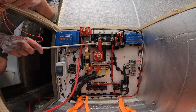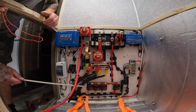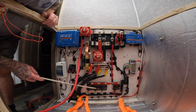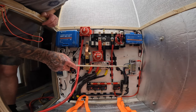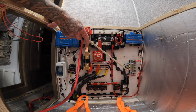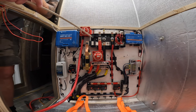Positive is on this one, negative is on this one. The next fuse is a 100-amp fuse that goes on to a wire, then to another bus bar where I have branch circuits and breakers. When they trip, I have to reset them. This one's for the happy jacks, there's one for the fridge, this one goes to the main 12-volt distribution in my camper, and this one here you can see the red wire — that's a small distribution block with fuses. I also installed this so each circuit is now on its own separate circuit. This small red wire feeds the lights in this compartment and the one above my head — LED lights I put in here.